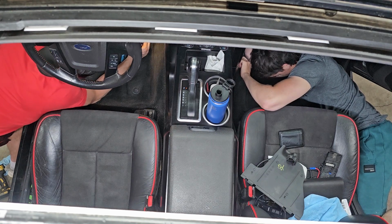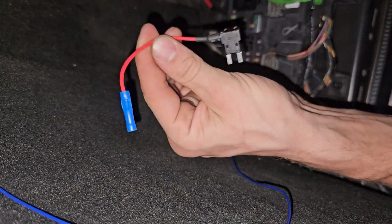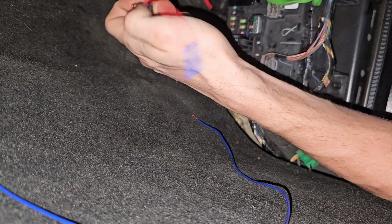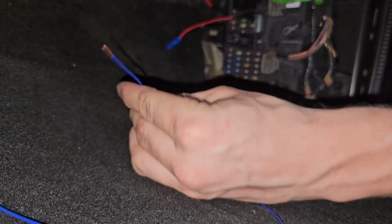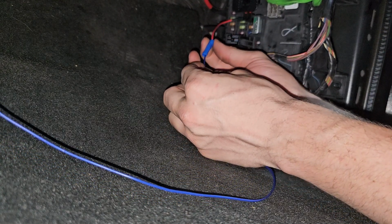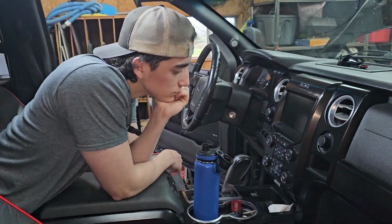Come on. Here, I'll go ahead and open it. You got the wire? Yep. Awesome. All right, so now we're gonna go ahead and throw this fuse tap in, which the fuse is right underneath this little connector, so we'll lift it up just a little bit and plug that in just like that, fits perfectly. You can close that as well and lock it. And here's our wire. We'll just shove this in here loosely just so we can test it out. We still got the battery disconnected, so it should be fine. All right, that should be good. Just making decent contact there. It's not crimped or anything, but now we can go ahead and plug the battery back in and test, make sure those lights are working.